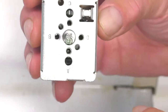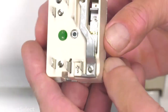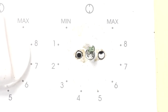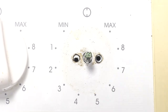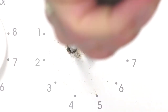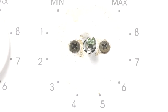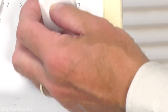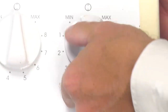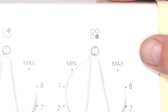Now, when installing the new one, we want to make sure that we put it in the same position as the original — so facing the back, this would have been the top. We'll slide it into place and then reinstall the mounting screws. Tighten them securely. Next, we'll take the knob to reinstall that under the control. Make sure the detent is at the top, and now we'll go to the back of the range and reconnect the wires.